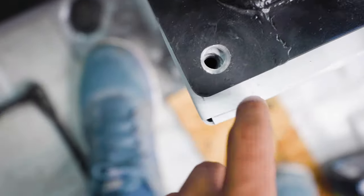I've been struggling trying to get this seat in literally all day. I've been on and off the phone with the manufacturer, and my problem is that the bolts just are not lining up — I can't even get in two bolts width-wise, it just isn't the right length. Basically what the guy told me is that when Mercedes builds these seats and bases there's very little tolerance between the seat track and the base, and there's no tolerance with his base. So he said my only option is to drill it down. I've been using a metal grinder on the end of my drill and you can see it's ground down quite a bit — that's kind of where I'm at.